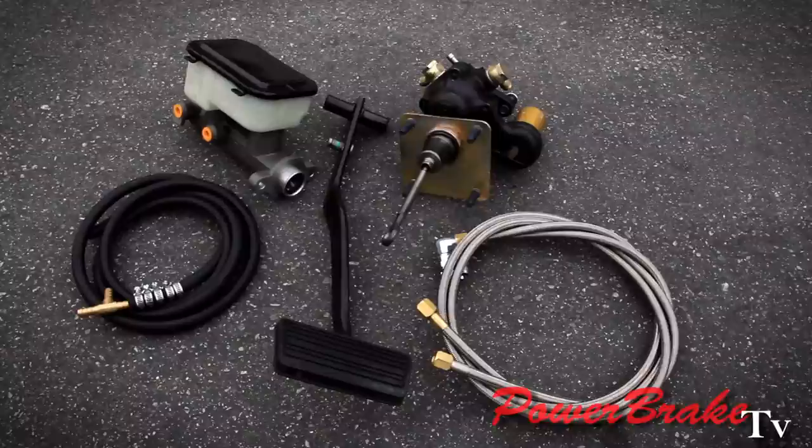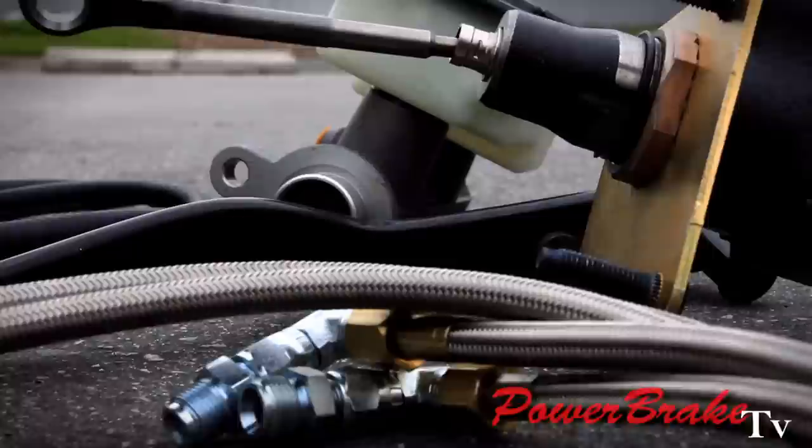It was all made worse when you put big tires on. The brakes were way underpowered from the beginning, and since the 70s they've put almost 80% braking up front. They designed it that way because they were scared of less experienced drivers operating vehicles with bald tires in the rain.